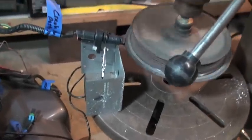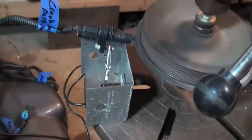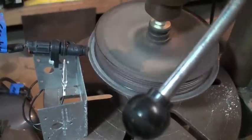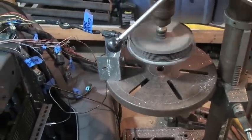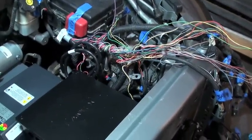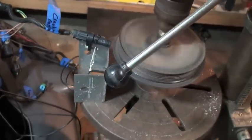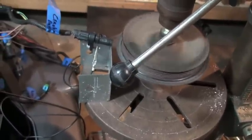This is my reluctance ring setup. There's a sensor and the reluctance ring is spinning. I'm not sure exactly how many RPM this is, and the sensor is right on it. Despite all of that, I'm not getting any signal. I don't know if my electronic control module has gone out or exactly why this isn't working. It needs more than just the crankshaft position sensor to give me any kind of data.